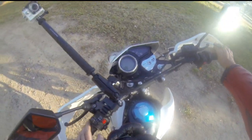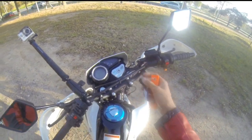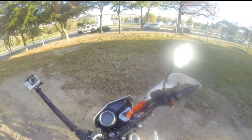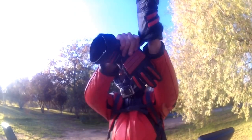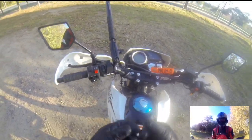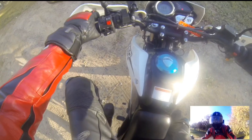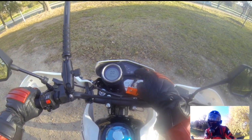Let's get started with the ignition. The first thing that I thought was kind of cool, but maybe a little bit gimmicky, was this thing's ignition. See, this key's got like a weird cutaway, and it's got like a weird slider over here that hides the ignition. It's kind of cool but it might be a little bit gimmicky. Apparently it only works for this key and the spare key. It is very important that I tell you guys that this motorbike is a very Chinese bike — I've only got good impressions of it so far. So let's do the starting sequence, shall we, because it's a carb bike. There's a little manual choke over here. I'm going to switch it into the fully choked position. Ignition on. I'm going to make sure I'm in neutral.